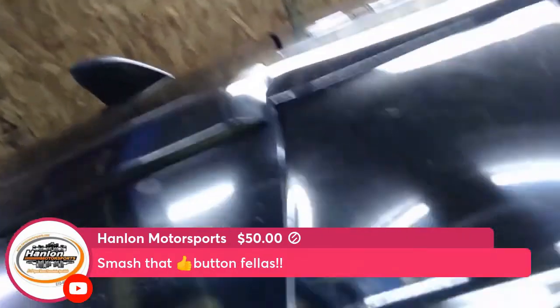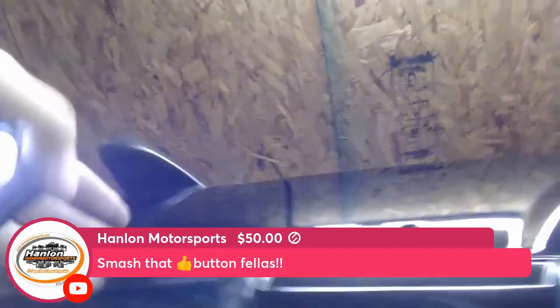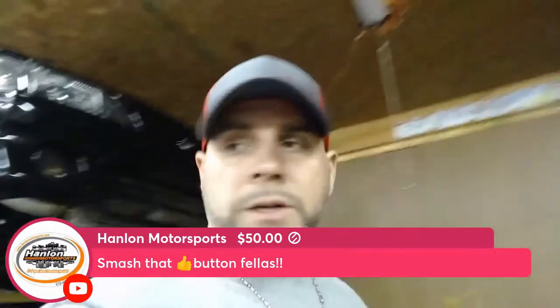I've got the car up. I don't know if I can reach it, but if you open the door, you'll be able to see inside. There should be an old sound deadener, and that's one of the things you should take out because it gets all wet. The pillar is definitely a concern. It'll affect the way your door hangs if it gets too rotted out. It's a supporting corner of your firewall and your cowl.